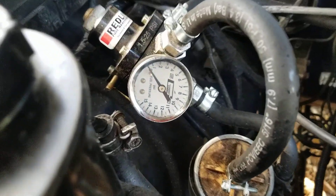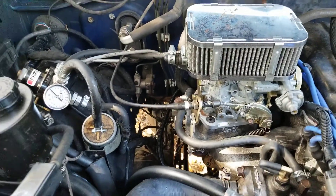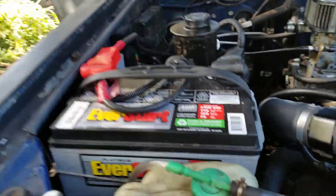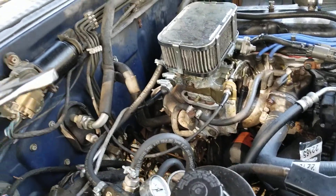The maximum you want to go for the Weber is 3 PSI. Any higher than that and you'll likely flood your carb. So the way you adjust this is to have your engine running and use a wrench.